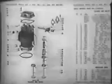You'll find an exploded diagram of the cylinder and valve assembly in the engine manual. You're concerned now only with the cylinders. Later, the valve mechanism will have to be gone over. PAL nuts are used on this engine to safety the cylinder hold-down nuts. Remove them first. It's always a good idea to string nuts on a piece of wire so they don't get lost.